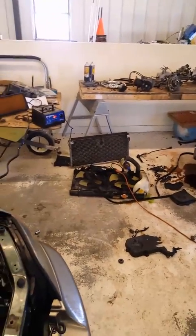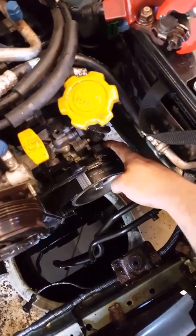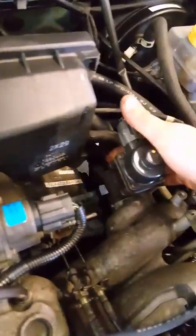The intake for the EJ25 is a lot more mechanical than the intake for the 2.0 — that one is pretty well electrical in many different ways. The EJ20 doesn't even have a camshaft position sensor or the EGR with the tube that goes down to the exhaust, so you've got to swap things out and modify a lot as well.